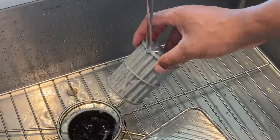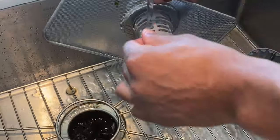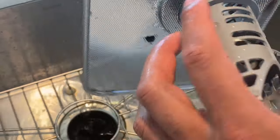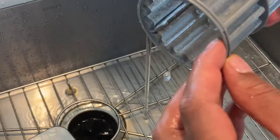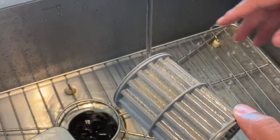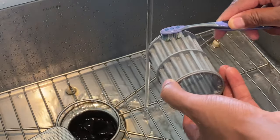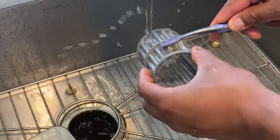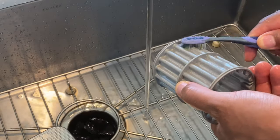Try to rinse as much as you possibly can off with just water. Look at that gunk — you want to get all of that off because that's making everything smell. Make sure you get all of that off the mesh. If you can't get as much off with rinsing water, you can also detach the filter body from the mesh by pressing in the little snaps on each side and pulling it out. Now you have it fully separated and can clean it even more thoroughly. If you look closely, there is a lot of gunk as well as calcium deposits. So take an old toothbrush and scrub along it to loosen and remove the gunk, then rinse it off.